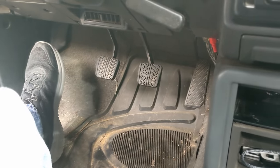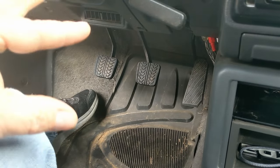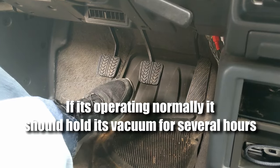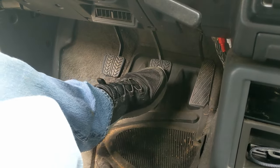So how can you tell when your brake booster is going out? Generally, with the vehicle turned off for a while, you would get about three presses before your brake pedal got hard or really stiff. Mine is already hard from the get-go. What's been happening is I've been hearing a hissing when I turn the truck off, and when I press the pedal it goes from soft to hard and it quits hissing. So I've got a little bit of a leak, probably in the diaphragm of the brake booster.